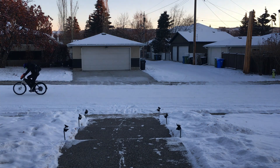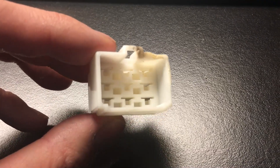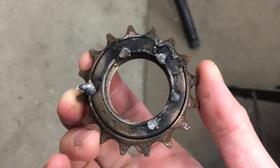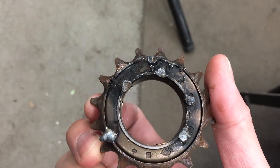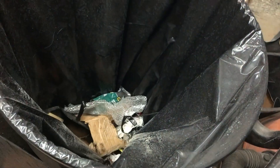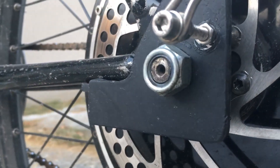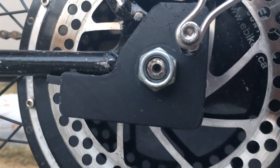But what's the moral of this story? Among the technical lessons: don't try to run 30 amps through connectors rated for only 12; a cheap freewheel isn't worth it because it seized and the only way to get it off was to weld the inside to the outside; and you need a torque arm, because the dropouts aren't enough to keep the axle from rotating and winding up the wiring like fishing line.